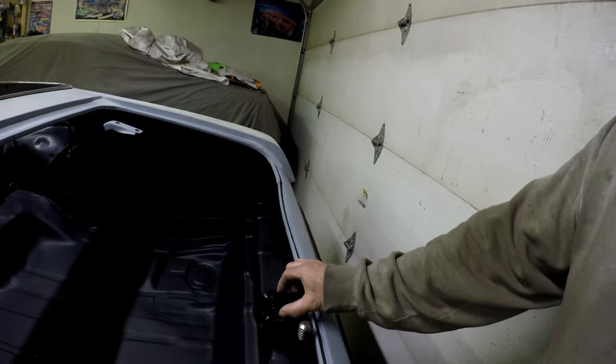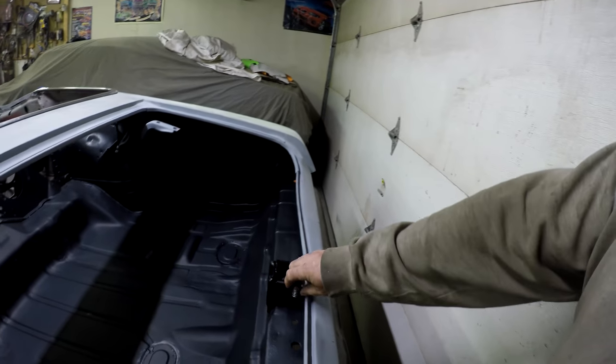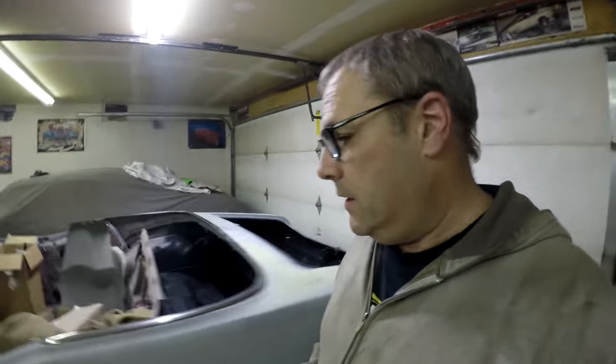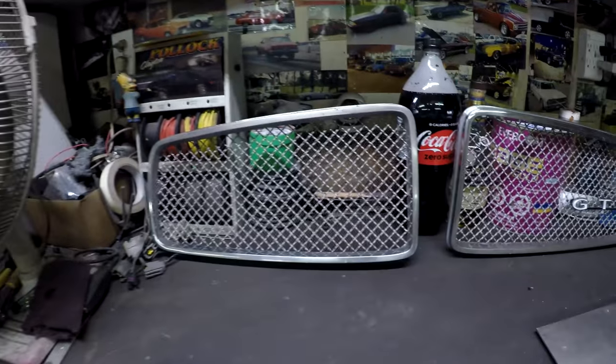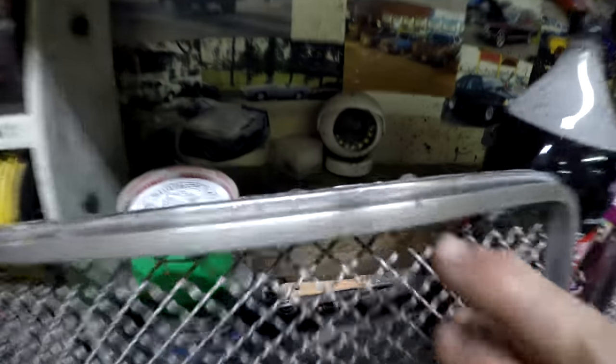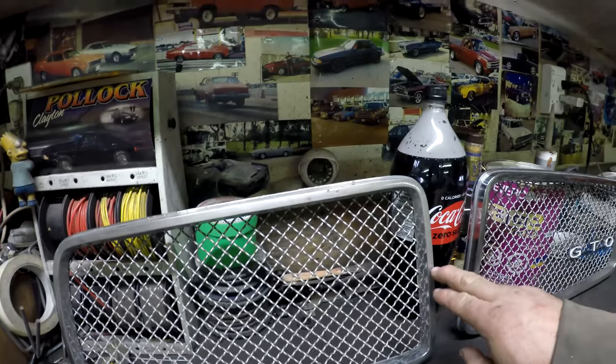I ended up painting this part and putting it back on. I took the trunk lock off — it was here — welded that up and put in an electric popper. But the trunk is so heavy because of the spoiler that I needed a little spring to help pop it up, so I made that. I also ended up taking the wiring harness — the one that goes from front to back for the tail lights, and the harness for the rear power windows — taking all the tape off, inspecting all the wires, and re-taping it. Then I took the grills, cleaned them all up — they're not perfect, they've got a bunch of pitting in the chrome. They don't reproduce these, and getting them re-chromed would be expensive.